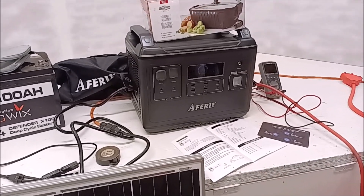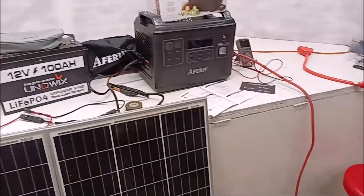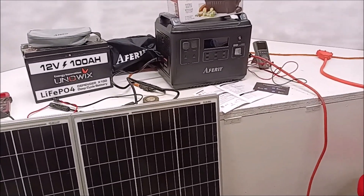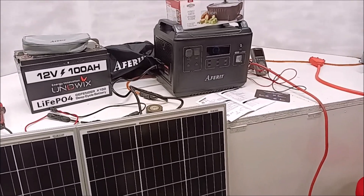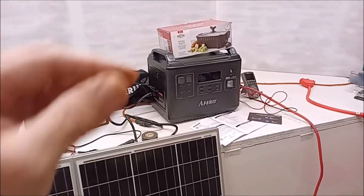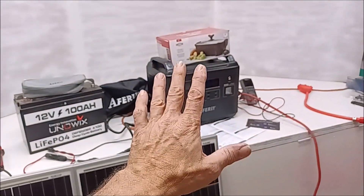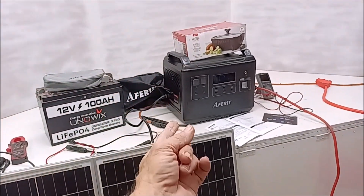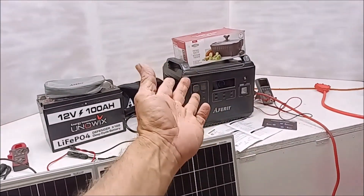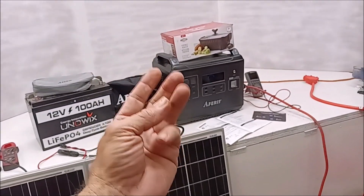It takes power to make power, takes power to make heat. The microwave wattage rating is how much heat it makes, not how much power it uses — it still takes 2,000 watts to run it. I'll put down below some appliances that will use a lot less power that could go with this for $50 or $60, so you'll have cooking, refrigerating, everything.